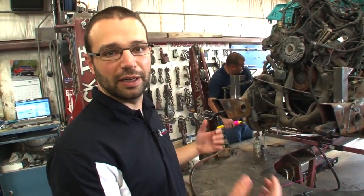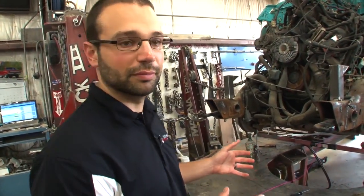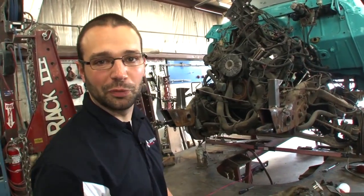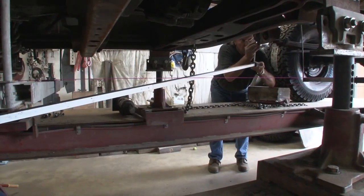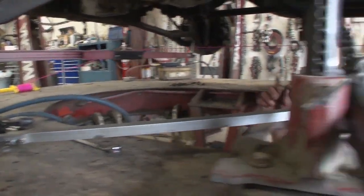What they did the first time was bring it in, just kind of eyeball it, tug it out, get it so they could set the body on it and get back to work on it. Now what we're doing today is the final pull on the truck, so everything has to be within spec on this pull because we're done after this. We're going to start getting the mounts completed, situated, gusseted — there's no grinding and re-welding hopefully after this one. The next step is to verify that we're true corner to corner and that measurement needs to be within three millimeters. Our measurement came in at two millimeters, so we're good, we're within spec — it's time to move on.